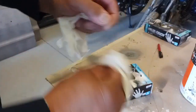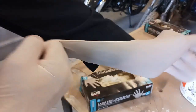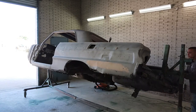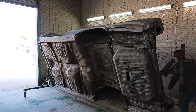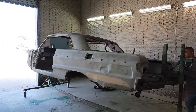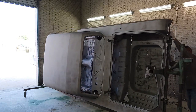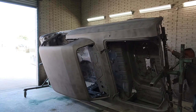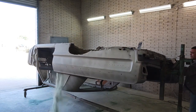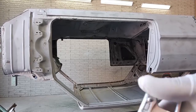If you're going to be handling any surfaces that have been media blasted, you must wear some type of glove — latex gloves work the best for us. We're going to be doing this blowing-out step about four or five times to get all of the media out. It's really important — you don't want to be applying your epoxy and run into a patch of media or sand that blows all over everything.